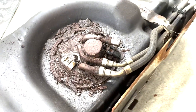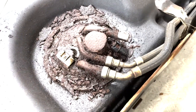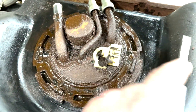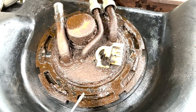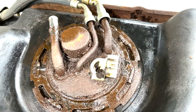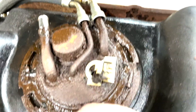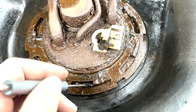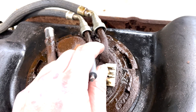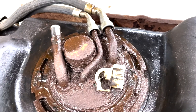I'm going to get a vacuum, sweep all this stuff off, get these fuel lines off the sending unit, and try to pop this thing out. A quick little tip: this stuff right here is Penetro — we also sell that on our website, it's what we use in the shop. I took a little screwdriver and broke up the buildup around the fuel lines and then sprayed Penetro in there.